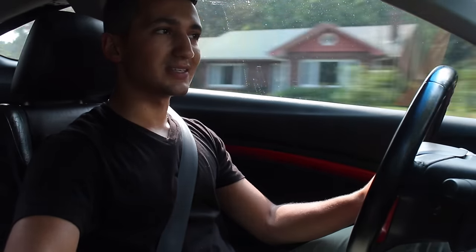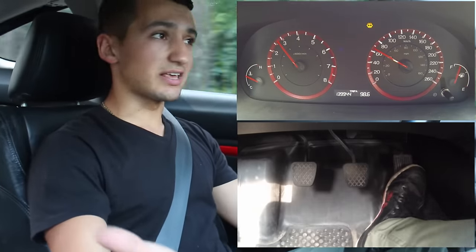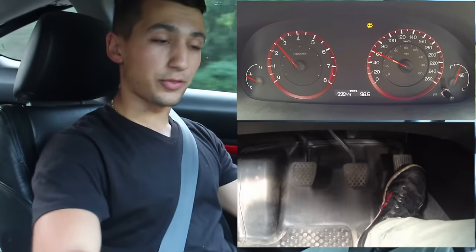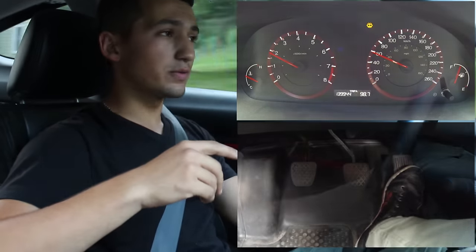The premise of this is basically the exact same as driving a normal standard car. All that it involves is pressing the clutch pedal once more between every shift. It's not that difficult. Right now I'm in fourth gear and I'll double clutch downshift to third. Ready? Watch the footwork. Just like that. And I'll do it from third to fourth. You notice that it's very smooth?